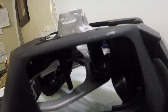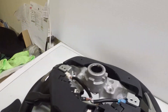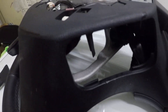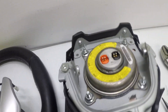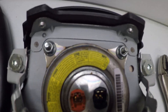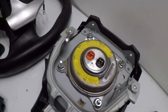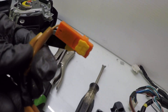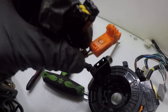On one side you will find a Torx T30 screw. Unscrew them on both sides and the airbag drops down. There is an airbag connector on this side — make sure you carefully disconnect the plug from the clock spring to the airbag. You need to lift the yellow tab and carefully pry it up.